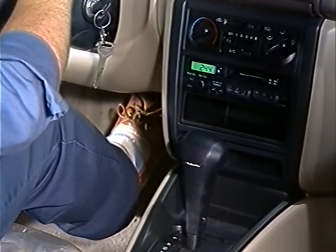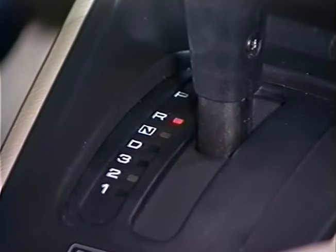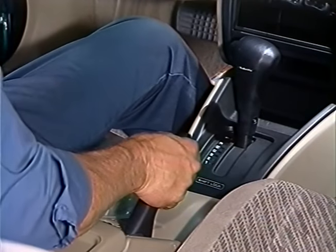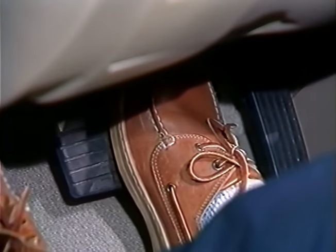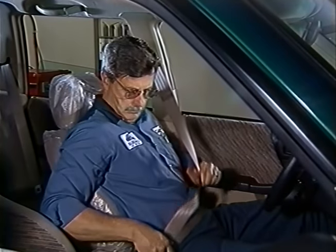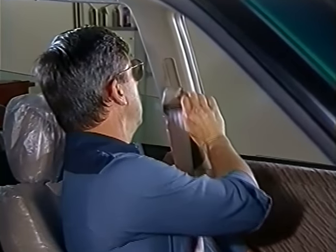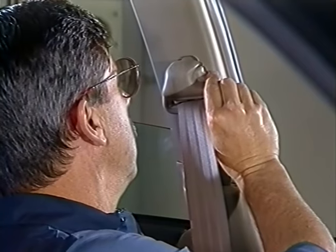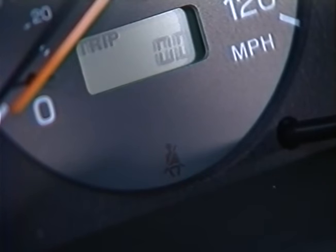Apply the brake pedal — this releases the transmission shift lock. Shift the transmission into reverse. Make sure the red indicator bar properly aligns with the R. Apply the parking brake and make sure it is properly adjusted. Step on the service brake pedal and make sure there is some travel. Now fasten the driver's seat belt and check it for proper operation. Check that the seat belt height adjuster works. Check that the seat belt chime and warning lamp go out when the driver's seat belt is fastened.